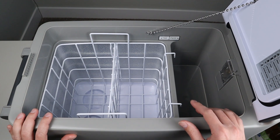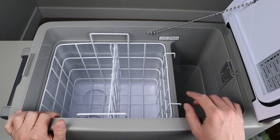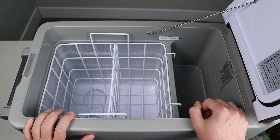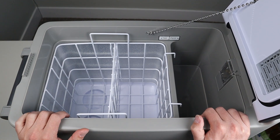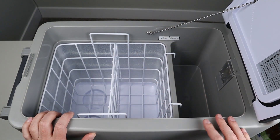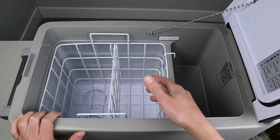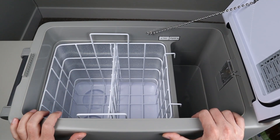Looking at the inside, you can see there's a metal liner on the large area. The evaporative coil runs right around the top of the fridge, and the metal liner is more efficient because it allows cold to transfer into the fridge much more efficiently than plastic — thumbs up for the metal liner. Another great benefit inside this fridge is the basket. As these fridges get loaded with food they get very heavy, so if you want to move it, you can easily take the basket out with the food in it, lighten up the fridge, move it where you want, and put the food back in. The basket also protects the sidewalls and bottom if you drop something, and if you spill something you can just take it out, rinse it off, wipe everything down, and put it back — no tunnel shuffling required.